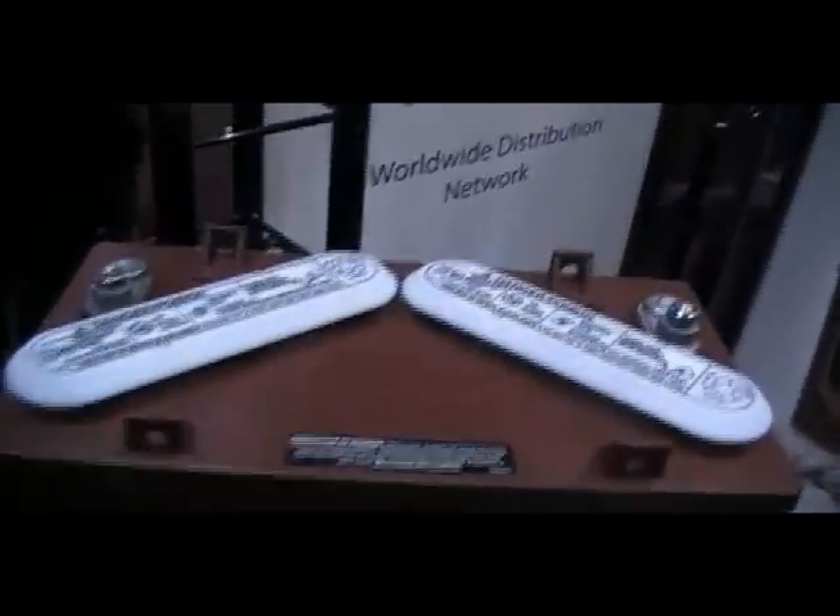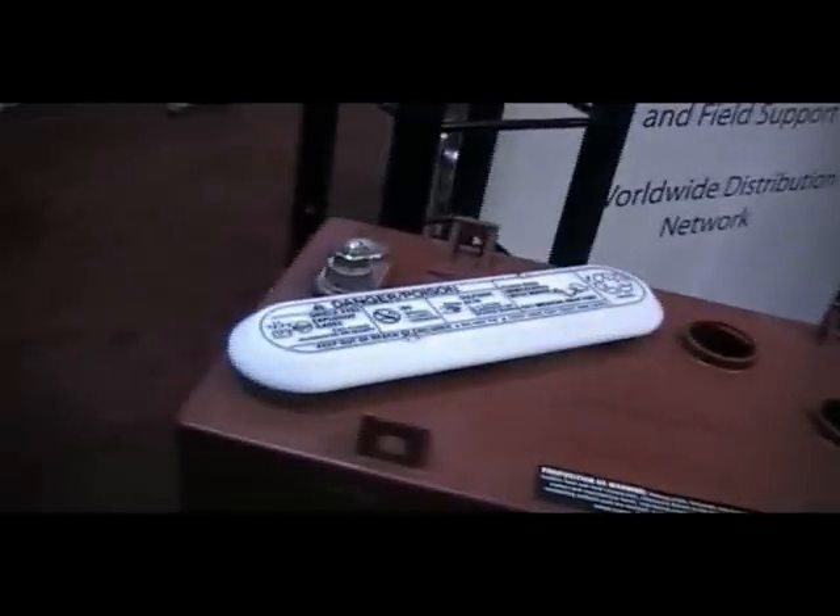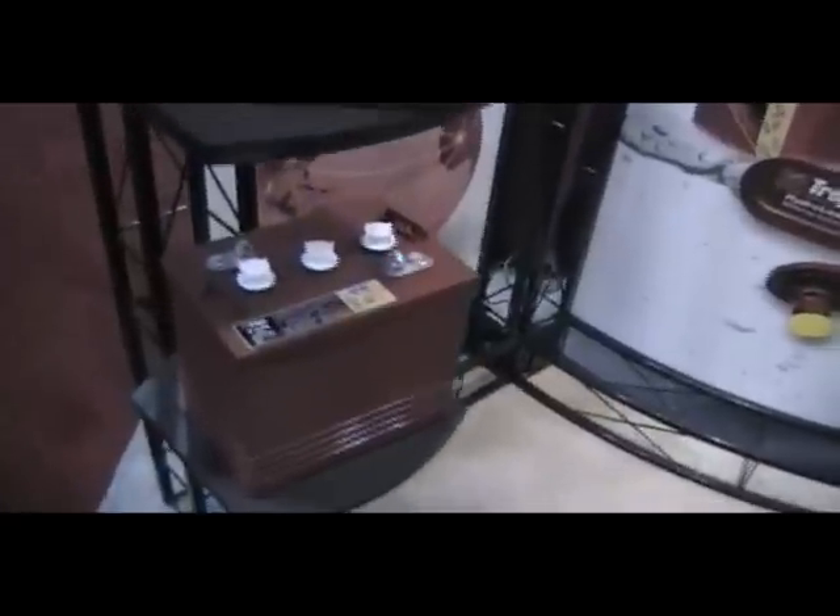Here we have a 12 volt battery, and again the V-cap gang cap. This is a 12 volt — you've got six holes, two volts per hole. Here down below you have a six volt battery, typical in a 36 volt golf car, again with the bayonet caps.